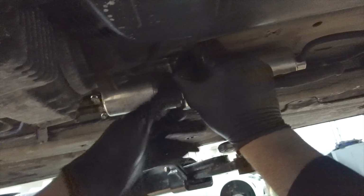After that, the hose clamps were tightened down enough that it wouldn't twist on the fuel filter ports. The only part being reused is the rubber sleeve around the fuel filter for the bracket holder. Before the fuel filter was installed, replace the rubber vacuum line going into the fuel filter regulator.